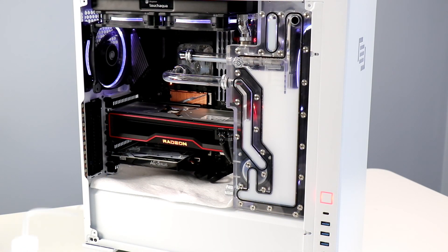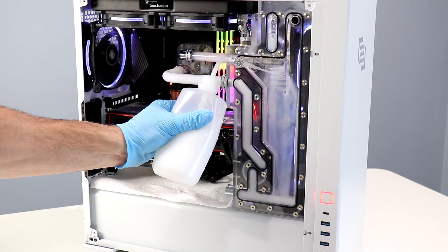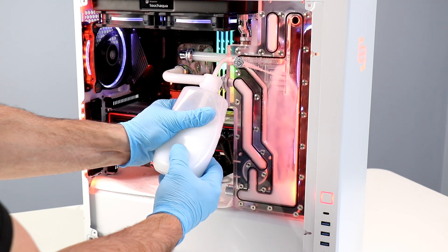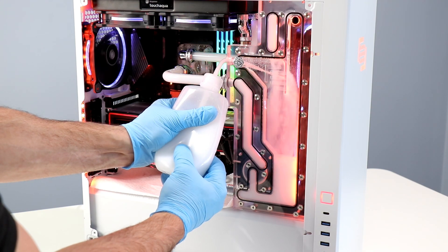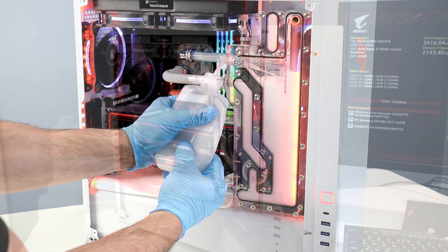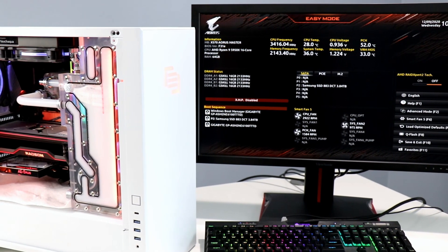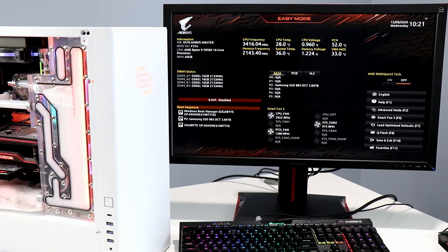Alright, the moment of truth. The CPU block is dry, but fear not — when I hit the power button it won't be for long, and that block will actually keep the CPU cool for even a minute or two on boot before heating up. It's just a bit of a race to keep the block as full as possible as the system pump pushes cooling liquid through. Two hands for this one — and she boots! We've still got a few air bubbles to work out, but that's not too hard by pushing a little more coolant in and mopping the bubbles up as they flow out of the top of the block.